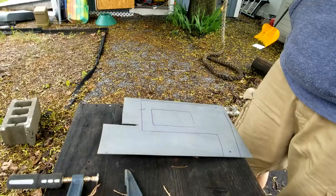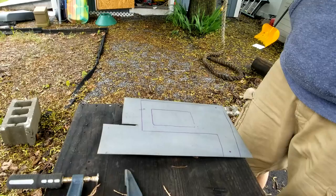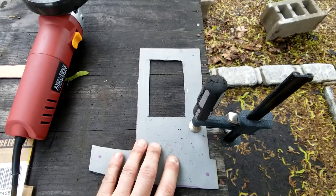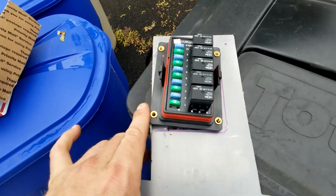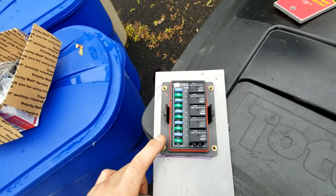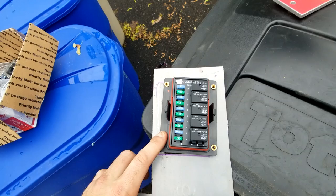There's the rough cut out of steel. I'm going to drill the two mounting holes and the four screw holes for the box, and that's my point for welding. Before I clean it up I'm going to do a test fit — it fits. I decided rather than drill the four mount holes I'm just going to use self-tapping screws and tap right into the base once I'm ready to mount everything. I think that'll work fine.